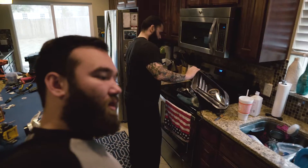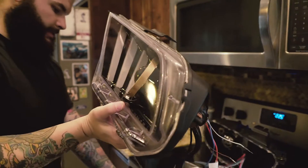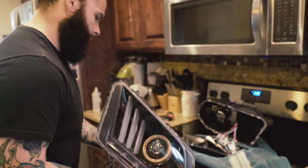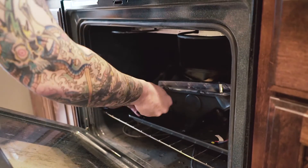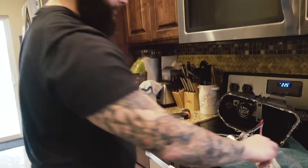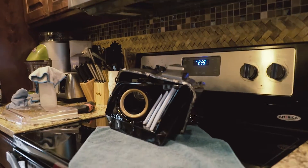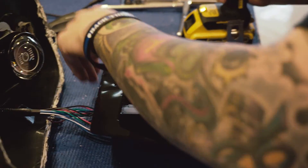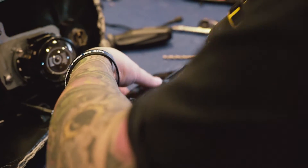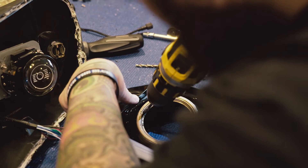Today on cooking with Matt — we're going to add a switchback halo to the face right there to give them a nice running light. We're also going to adjust the projectors. The custom brackets made to upgrade the bi-xenon projector have a slight alignment issue, so we're going to do some shimming of the brackets to get it all taken care of. Once we're done, Chance will have a nice even cutoff and the lights will look super killer. Ideally you pre-drill all your holes so you're not going to have holes that show color, but because we're adding these after the fact it's not really a choice.